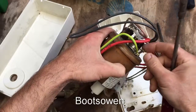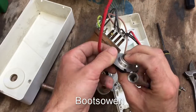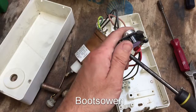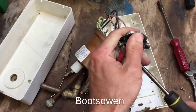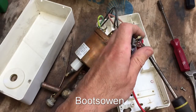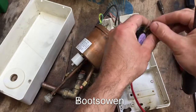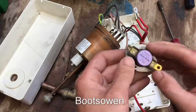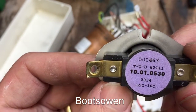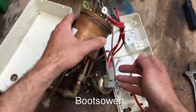Let's get in here on top. Brass screws, and there's your thermal switch - that's a resettable one. You'll remember one of my first shower videos was of a red ring shower, and that red ring shower was just awful. The thermal switch kept tripping because of the way it turned off - you could turn off the water but the boiler element would keep running. It was just a disaster. I don't know if the same thing could happen in here but I presume it hasn't. I'm looking for a date code - I don't see it. None of those stand out as a date code.